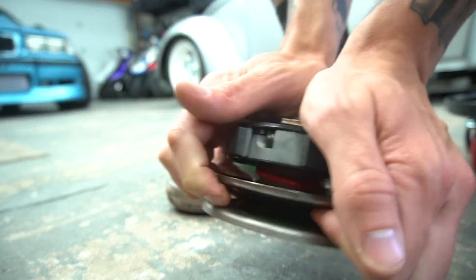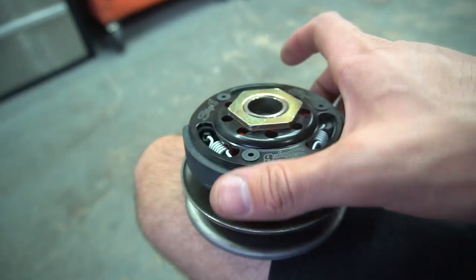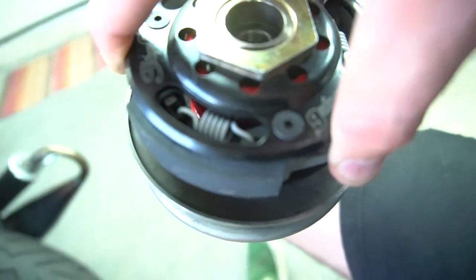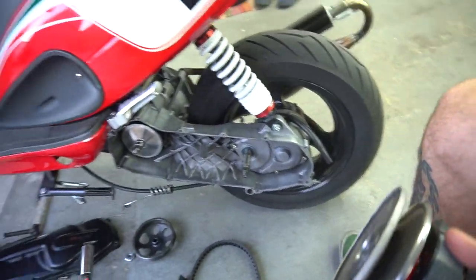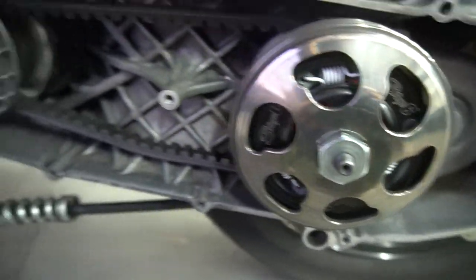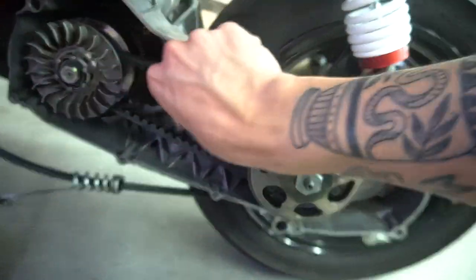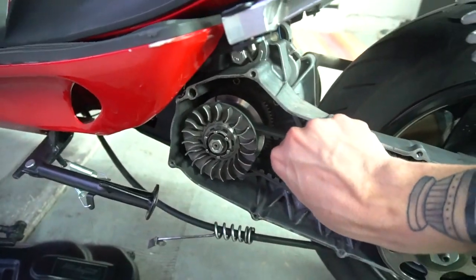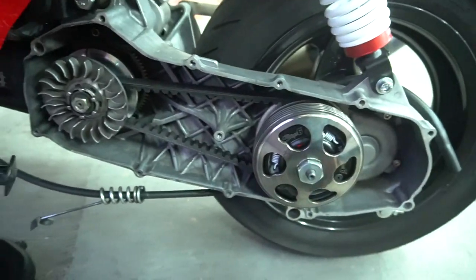See, now with the new setup I can barely even open the pulley. That's a stiff one now. Like I said, these clutch springs might be a little too soft - these are the softer ones, but we'll try it. Two-case contra spring in there, Stage Six ones - I got them almost maxed out, tightened. I'm worried about this belt fitment now, so I'm going to try to do what I can to make it fit a little better. She's looking nice all in there. Time to throw the cover on. We still have room to improve - I literally don't have any more room for shims up front, so I think we need a different size belt, honestly. A little bit of a longer belt to make this work.